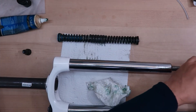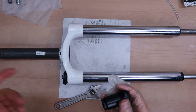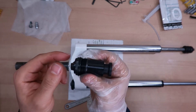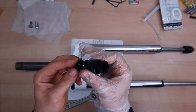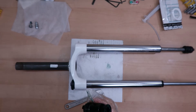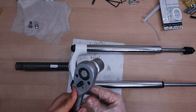I'll put this in, then put the bottom-out, then put my spring in. Now it's time to put back the top cap. What I usually do is put a bit of grease on this part here that basically rotates on the spring and applies tension — if you want to preload the spring you can rotate this clockwise and you see how this extracts and compresses the spring. What sometimes makes it difficult is that this has to rub on the spring while turning, so a bit of grease helps. I'll put just a touch and rub it on top. Before I put it on I'll just screw it back as far as it goes so there's no tension on the spring, and I can safely tighten this top cap with my 24 millimeter socket.